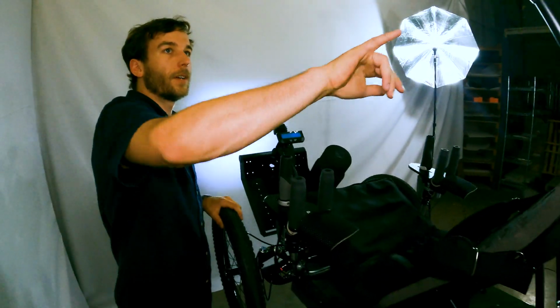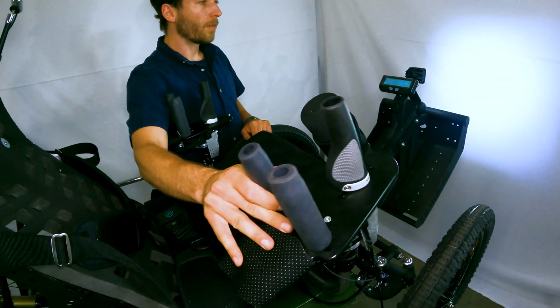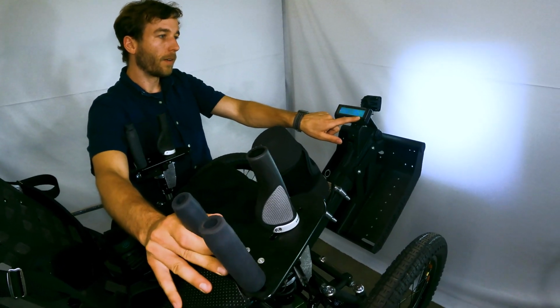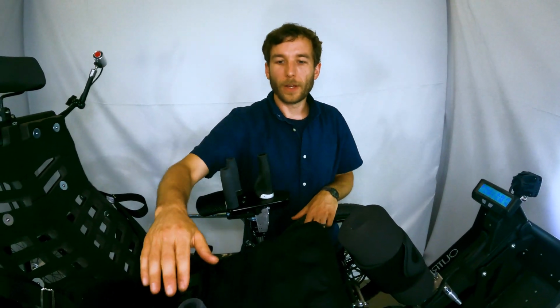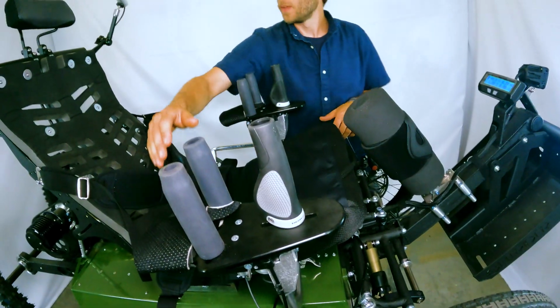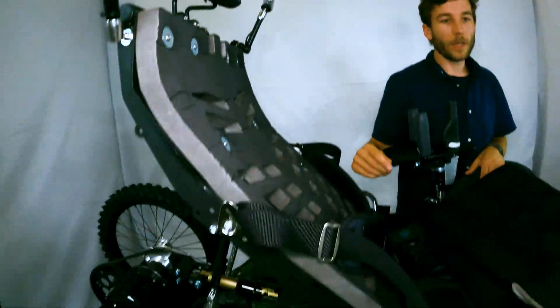So over here, this red switch is going to be the arm and the kill switch. So right now, if someone were to hop on this unit and hit the throttle and not realize what they were doing, there's an automatic safety that blinks the miles per hour there and says, hey, it's not going to go anywhere until you hit the safety switch. So that just makes sure that if somebody's messing around with the machine and they don't know what they're doing, or if they forget protocol, or a kid's playing with it, it's not going to go anywhere when you hit that throttle. So you swing your head over and hit this button, and you'll hear the controller fan come up.